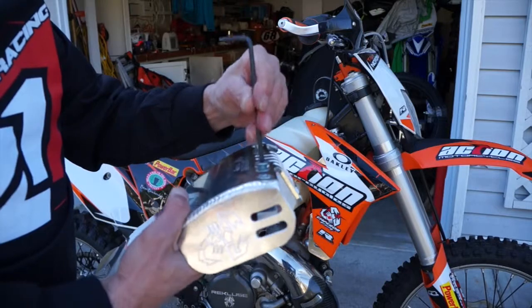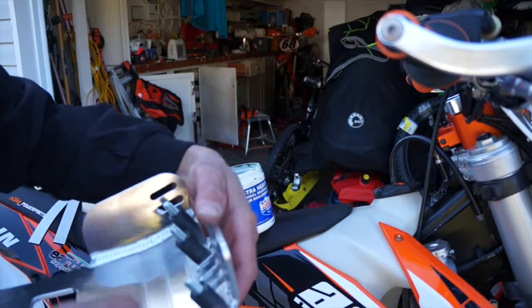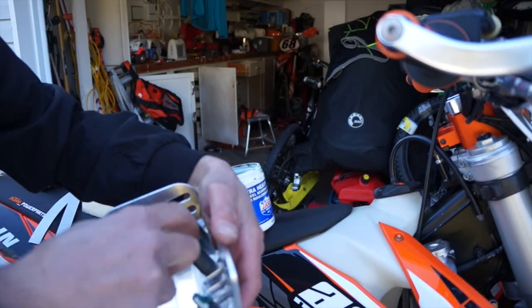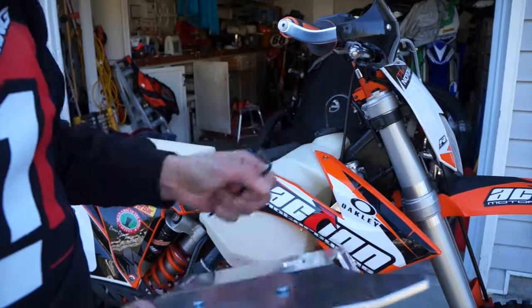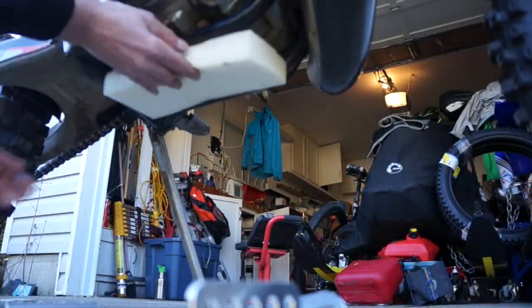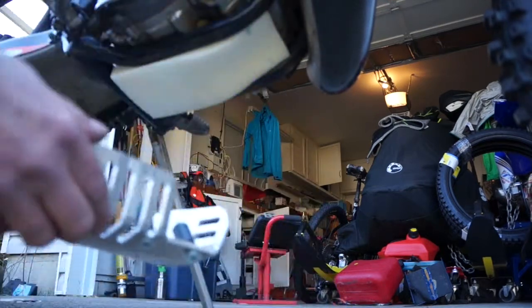The first thing you're going to do is back off the bolts of the skid plate from the backing plate. I actually like to add a little grease on those bolts just because down low in the skid plate it sees a lot of water and dirt, and if you're ever going to take it off it just makes it that much easier. Then you're going to loosely attach the rear clamp of the skid plate, and then move underneath the bike and install that piece of foam up in between the engine compartment and the frame — that's going to sit in between there and the skid plate.